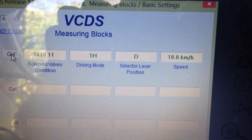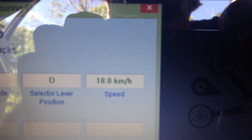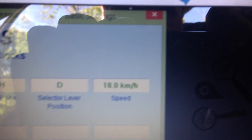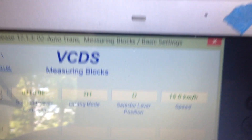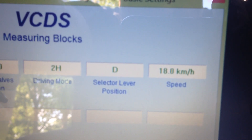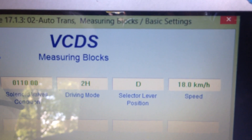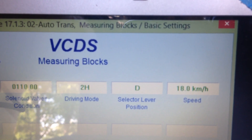It's going to get up to about 19 kilometers per hour, and that's where it's going to want to sit, just sitting on jack stands, unless I mash on the gas pedal. The gas pedal is right over here, so I'm going to reach over and mash on it, and we're going to notice that the speed is going to go up and the gears are going to change. You can also see the solenoids in the transmission — the binary code changes because the solenoids are working.